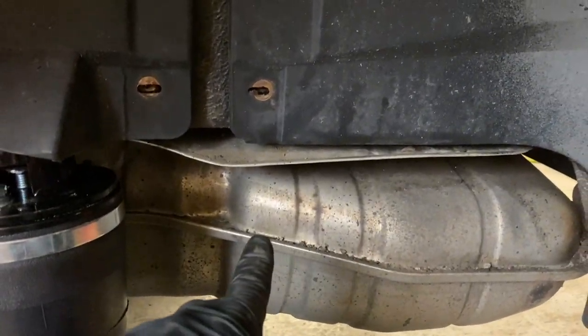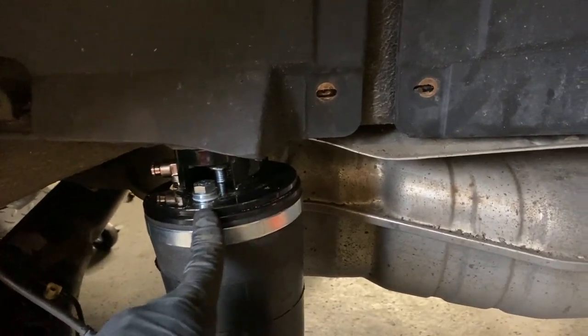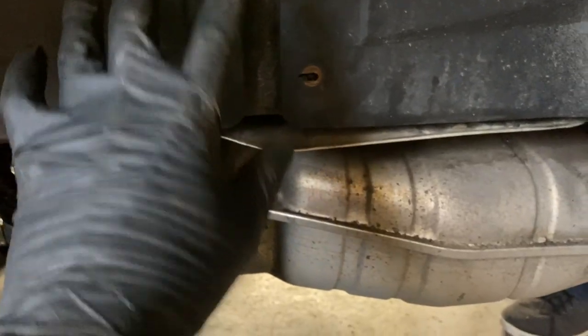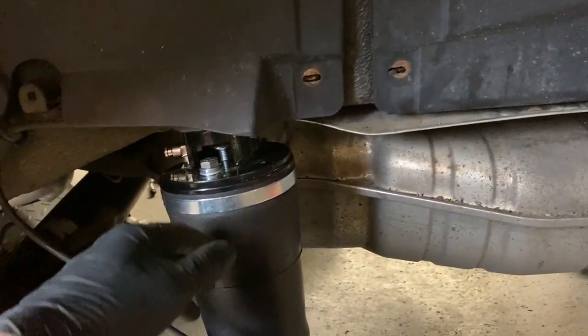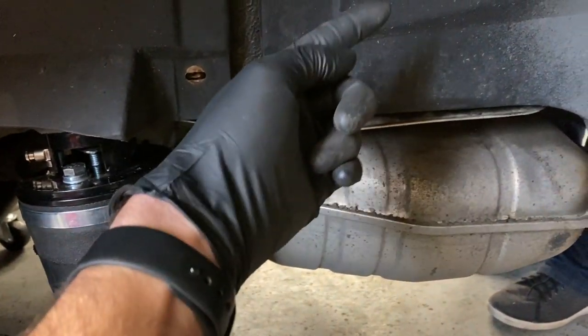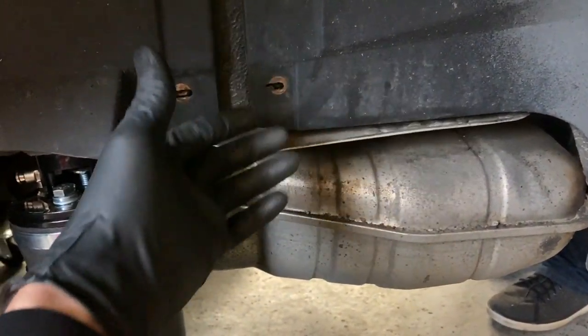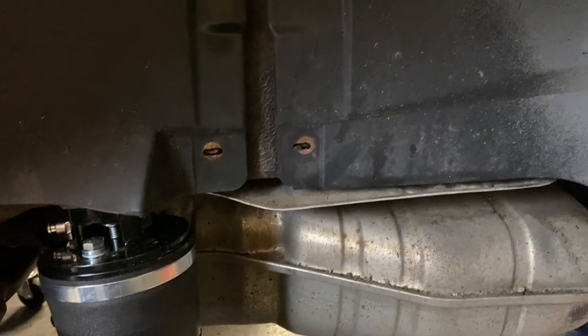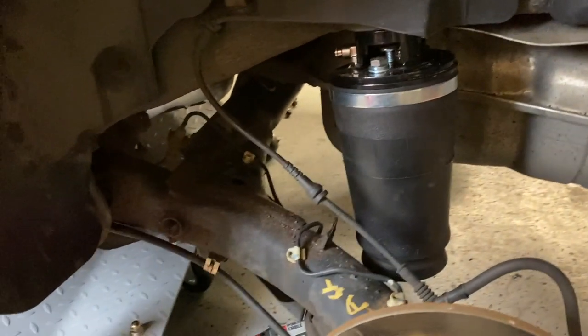Right, so the wonderful heat maker exhaust is kind of a problem. Did you catch that? You did catch that, didn't you? And we really don't have any good access here. The strut lays real tight to this whole segment here, so we really can't come back in and try to go in here. And I also don't want to put it behind here. Two reasons: you're creating friction, as well as giving yourself really poor access if and when you've got to do some repairs.